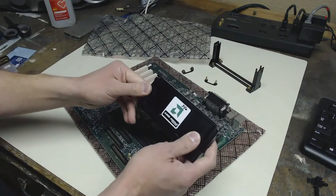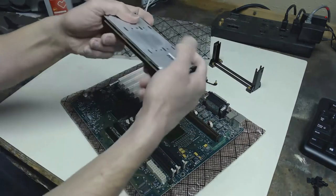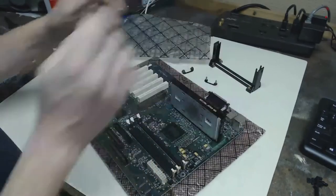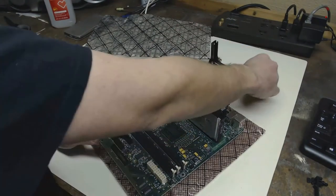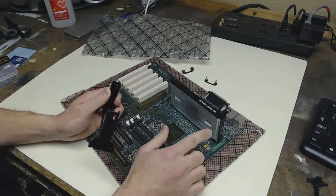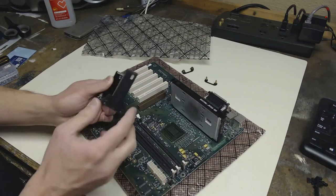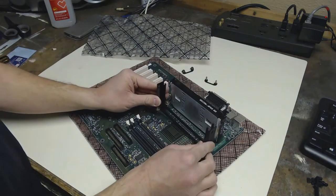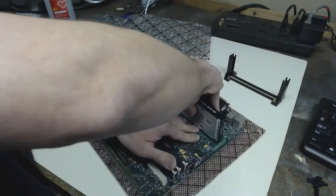As you can see, inside here is a little connector. We line it up with here, and this just basically slots in like that. Except this might sort of wobble around a bit, so that's what this is for. As you can see on the CPU, there's a little notch, a little tab here, and we have to turn this when we install it so that it faces the correct direction. I'm going to pull the CPU out real quick.